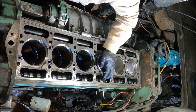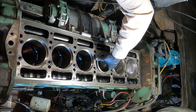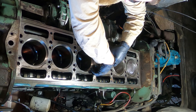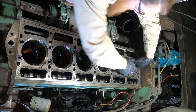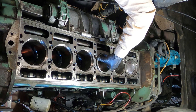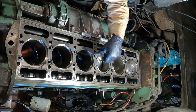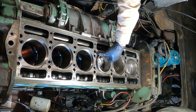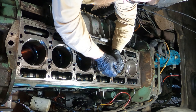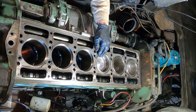I can't tell what's going on — maybe I can move it a little bit and then — oh! Why did it do that? It just slid all at once. Oh, it hit the top of the cylinder — hit the spacer. It's just hard to control, all of a sudden it just moves. It's hard to press by hand. I wonder if you let them go up too far — if the liner was really high and then went back down, that's the only way the rings would ever come out.